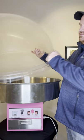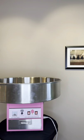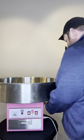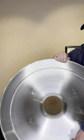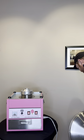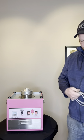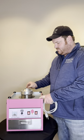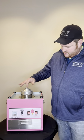Once that's done, you'll lift this up. You can now take this over and rinse it off with a garden hose because it will have cotton candy on it. Then you'll set it off to the side. You'll take the two snaps, un-snap them on both sides, and take the top off. This top you'll literally take to a garden hose, wash it and move it with your hand, and the cotton candy will come right off. Once that's done, unplug your power cord and wrap it up. Take a rag and wipe anything around the outer edge of the cotton candy machine, ensuring that it's not hot anymore. Once it has cooled down and you're not going to burn yourself, you can go in there and clean everything out.